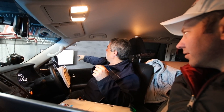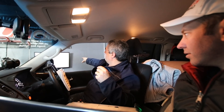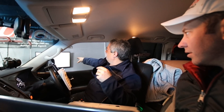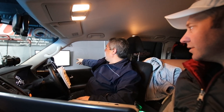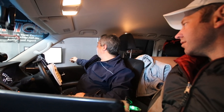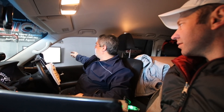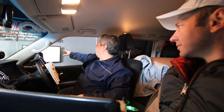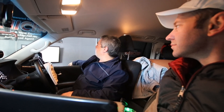The blue one is the 98. You can see the air-fuel ratio — it's about 12.5 at the end. With the towing map, it's just a little bit richer, but still a lot leaner than what it would have been standard — like 10.5 to one, which is sort of where you'd run with 20 pounds of boost. And I've done a 91 tune as well — that's the purple line — a little bit richer again, but still leaner than factory.